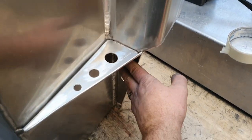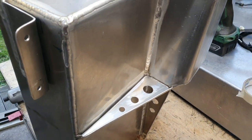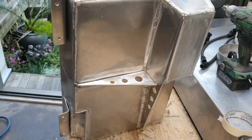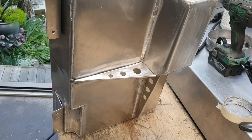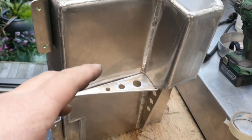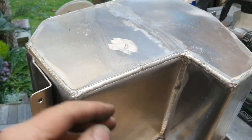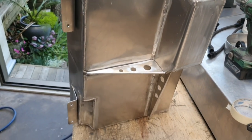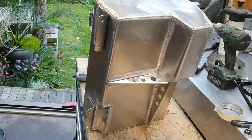The bottom is mint. Adding that gusset just gives it the support these bigger surface areas need under that large pressure. It's not so much the pressure you'd experience while driving — it's about impact on the tank. It's actually what brought down the Concorde: something hit the tank very hard, the tanks were extremely full with no ullage at the top, the shockwave sent through the tank blew it out somewhere else, and everybody died. A very horrible thing. So we need to say 'that's not going anywhere' — and now it won't.